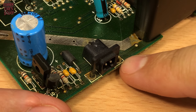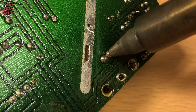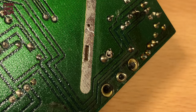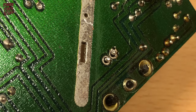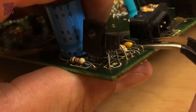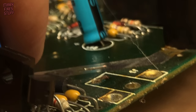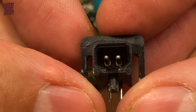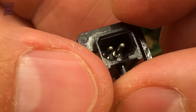Let's deal with this power port before we install the composite mod. Not only are the original power supplies hard to find, the connectors themselves are really non-standard and fail over time with wear and tear. Unhooking the legs from the board can be a bit tricky, but it will come out in the end. Even though these were keyed connectors, it was still possible to push the connector in reverse.